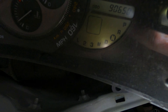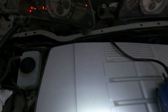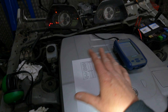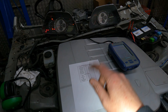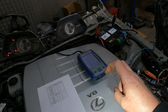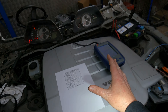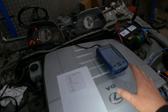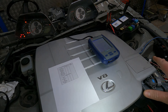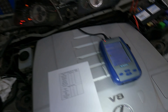Neutral, and drive. Just to remember — the six-speed doesn't have the additional lower gear positions. If you're using your original IS200 shifter, which is absolutely fine, just remember you're only going to have park, reverse, neutral, and drive. We have wired in S or manual mode — when you're in drive and push the shifter to the side, where it used to be three, it's going to put the ECU into sports or manual mode.